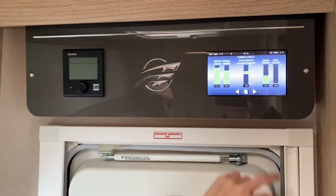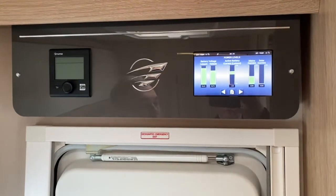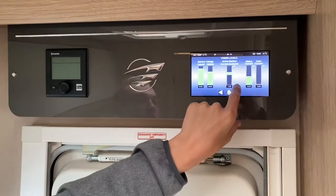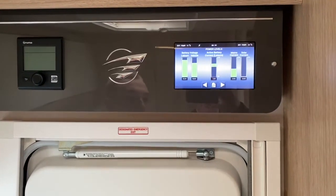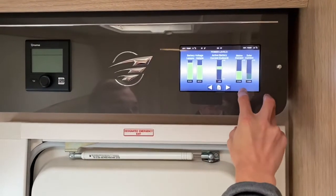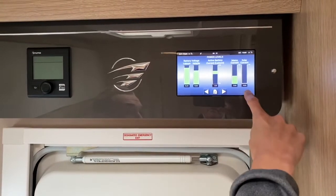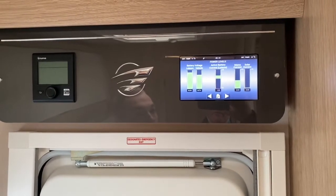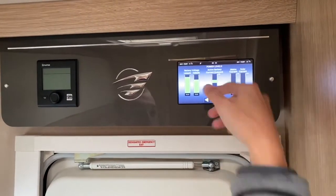You've got your active battery, which is your leisure. Always make sure your active battery for the motorhome is set to leisure and never the vehicle, because the vehicle battery will drain and then you won't be able to start your engine. This shows the amps coming off the battery — 1.4 amps because we've got the lights on. You've got the mains current showing what's coming in off your hookup. The hookup always takes priority over your solar panels — showing 0.0 amp — because it's the bigger power source. Once unhooked, the solar panel will kick back in.